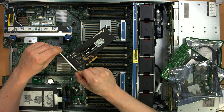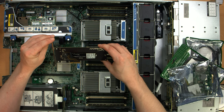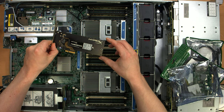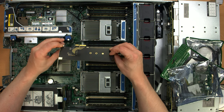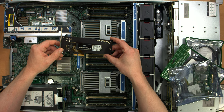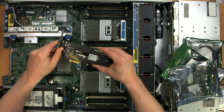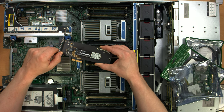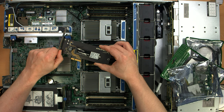I'm going to be using the HyperX Predator to boot off of. These are M.2 SATA — not even NVMe — but in a couple of my older workstation machines I'm still running these. They're reasonably fast and very reliable in my experience. I'm just going to have a single boot volume because I'm not too concerned about redundancy with boot — it's a backup server, and as long as I replace it and get it back up and running within a day or two, I'm okay with that.